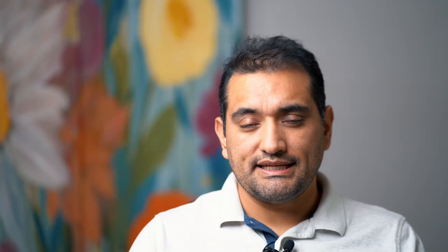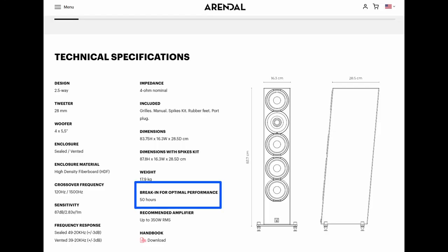Based on what I heard and saw in REW, I decided to go with option nine — the 3 dB boost in room gain and a 6 dB boost in the GUI menu. It added that extra kick I was looking for in music and movies without having to go really loud. In the Dolby demo measurements taken at -25, the Anthem is reaching around an average of 102 dB, so it's still more than enough. Since I got new speakers, the manufacturer suggests a 50-hour break-in period, so I'll probably rerun the calibration in a month or two.